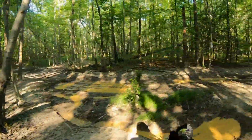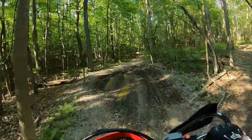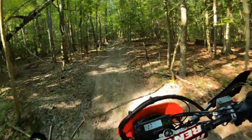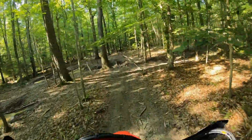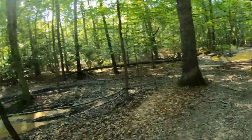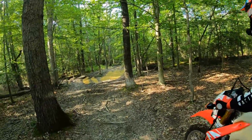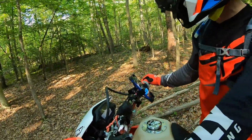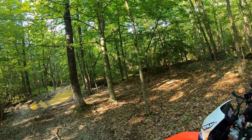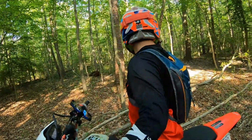So, at this point, I'm just going to ride the rally. Buying this bike was actually kind of a good thing, because it allowed me to do a lot of maintenance to the rally that I had been putting off. A lot of things have happened in the past 2 months, and with me being laid off and the whole COVID thing, I ended up blowing the front fork seals out on the rally, because the stanchions, the chrome parts of the fork, were pretty dirty, and when I hit those jumps a couple episodes back, I pretty much got close to bottoming out the suspension.